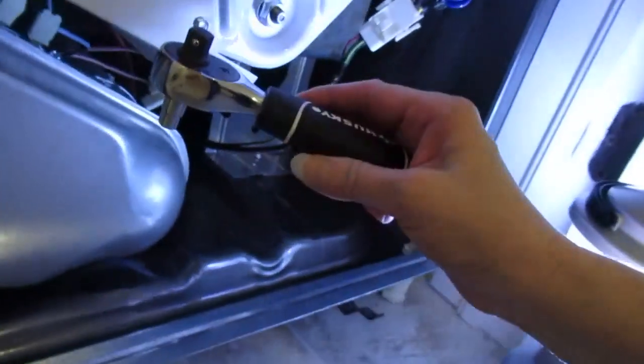It's a small part, similar to the thermal fuse. It's held on by two nuts, but you can't use a regular nut driver here — it won't fit, so you need a socket wrench. The wires were a bit stubborn to pull off again, but this time I knew to use the pliers, so I got it off. The thermistor is blown.